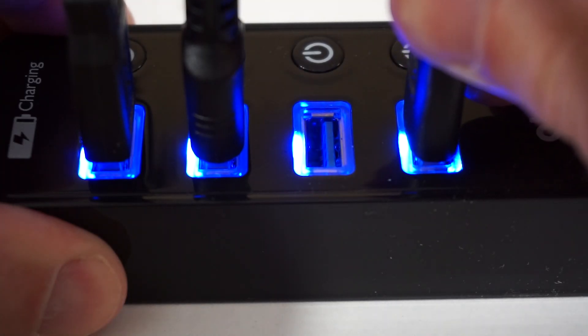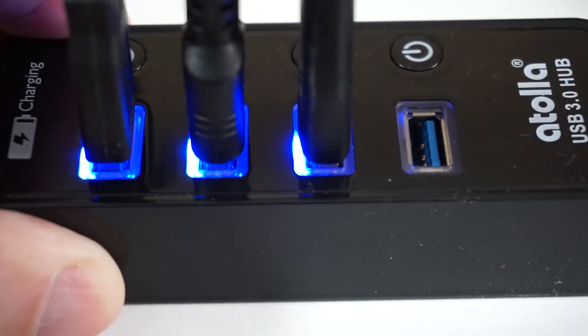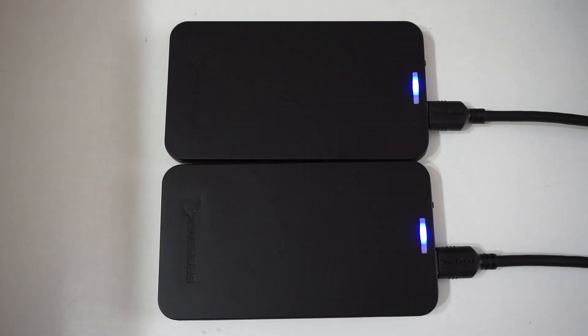The alternative is to use hard drives with their own external power supply — the majority of 3.5-inch external hard drives come with their own. Another thing worth mentioning is that because the Pi only has two USB 3 ports, you might end up using a hub anyway to connect more drives. The Raspberry Pi can use drives individually or in combination in RAID setups. I experimented with one, two, and four hard drives in different RAID configurations to see what kind of performance you get over the network.